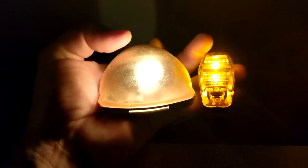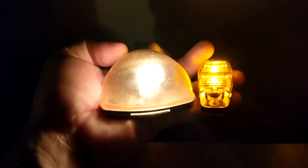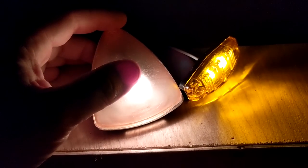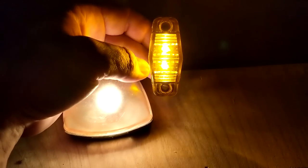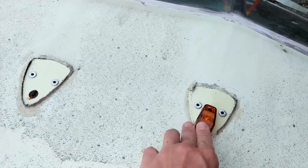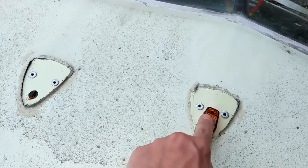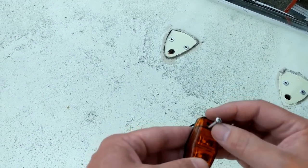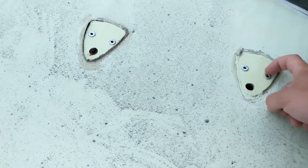These two LED bulbs are plenty bright — even mounted sideways, the light coming forward is brighter than the stock incandescent bulbs. This left one's cover is practically clear, barely adding any color, while the right one is more colorful and brighter even at this angle. I can feel heat coming off the incandescent bulb — it's a very inefficient bulb, burning through the battery. This more svelte LED solution will be legal, plenty bright, and lower profile. I'll pop the rivnuts out and patch that up — I'll use sheet metal screws into the SMC fiberglass, which will hold just fine. The rivnuts sit proud and make it even less low-profile.